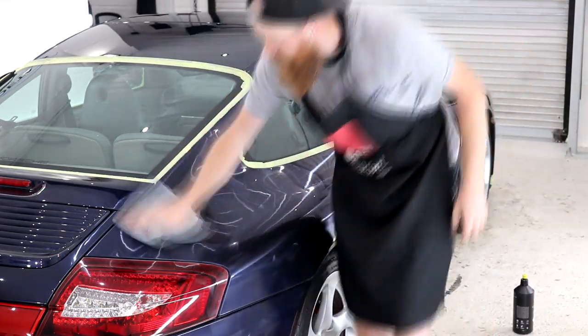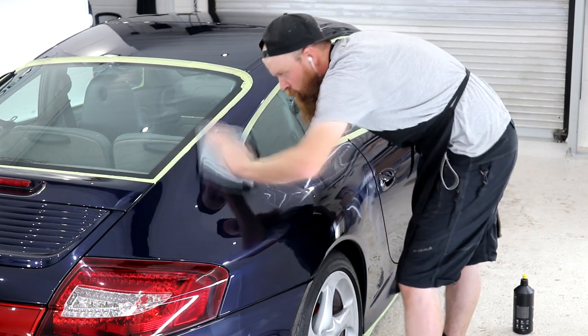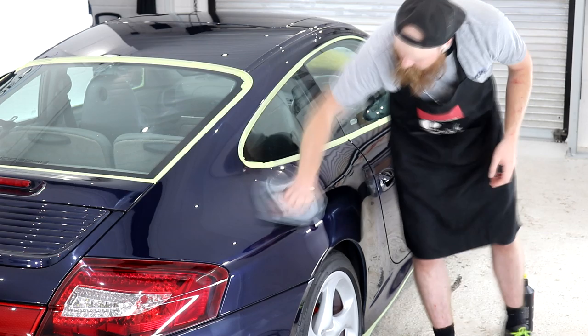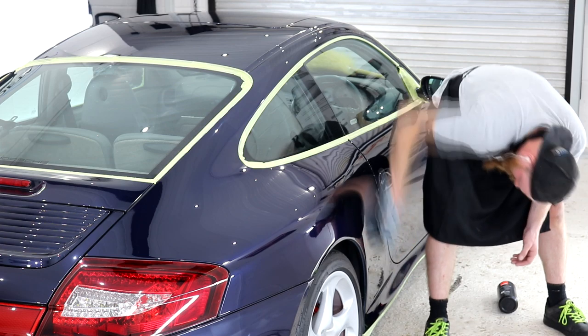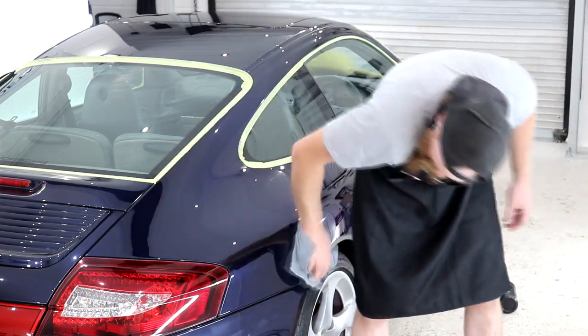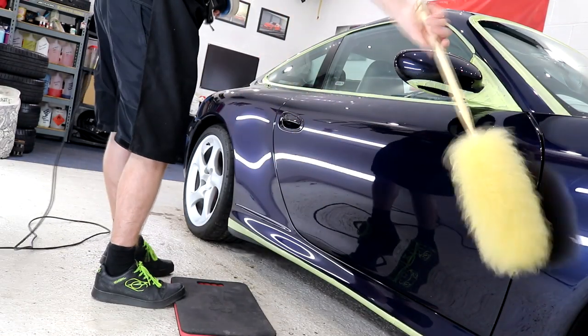This slower speed is going to allow for an even greater finishing process, simply to ensure any holograms are completely removed. A technique I use on a lot of vehicles that undergo a minor paint correction detail, and by doing this slower finishing pass straight after the main polishing work, due to the polish residue still being on the paint, is going to save you a bit of time with only buffing the residue off once and not twice.